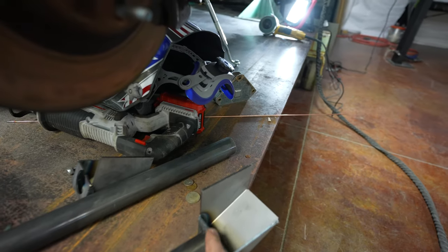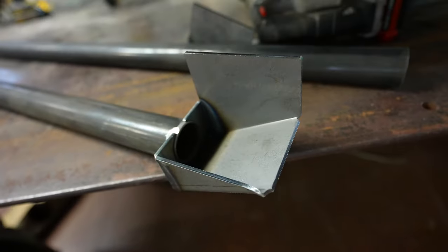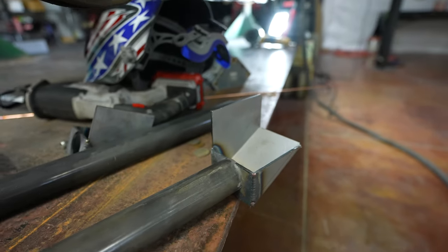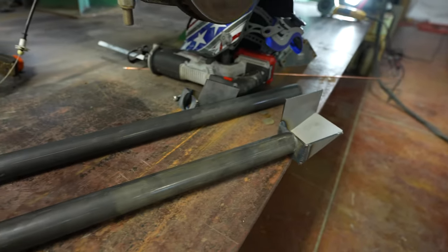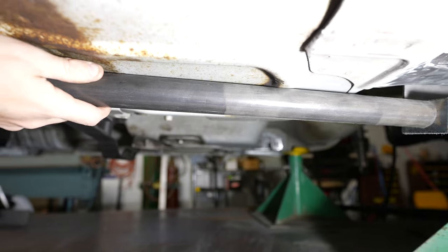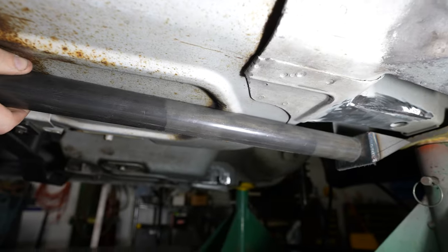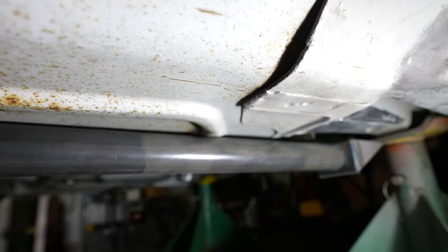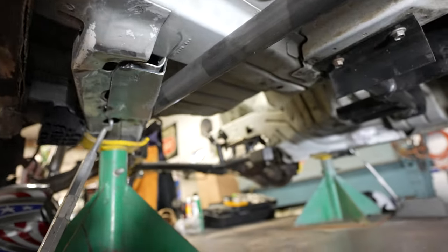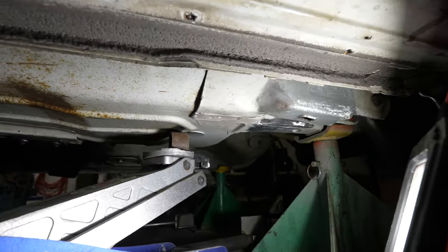All I had to do on this is take my flap disc and clean off the edge a little bit, and then this plate slid right on — it actually goes all the way through into that plate, so it kind of holds itself. I'm running into one little issue though: it doesn't go all the way up in there because it's hitting the floor. So I need to notch the floor just a little bit, or knock that in a little bit to flatten it so this can go up and tuck to it. Working on clearancing this little area right here where the tube kind of rubs.